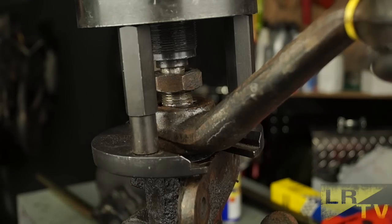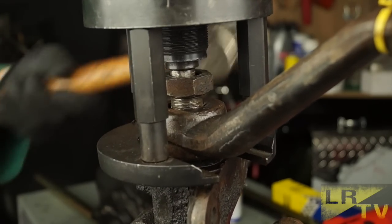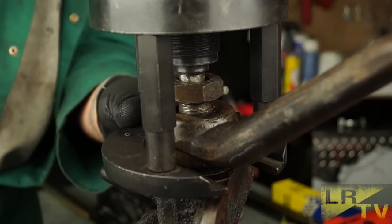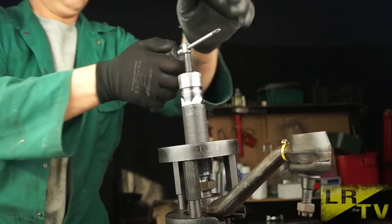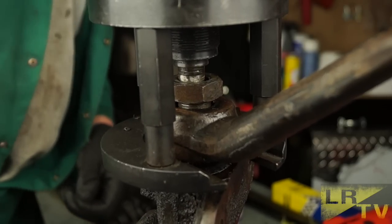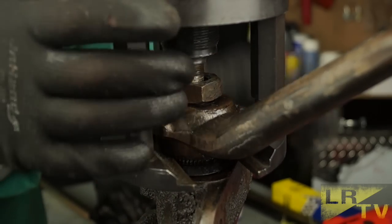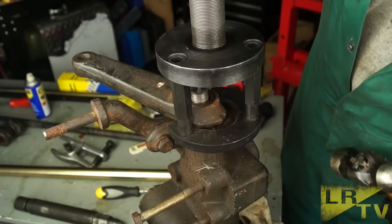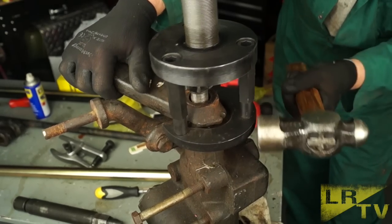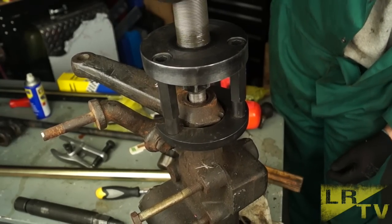On our TV channel, we like to review stuff and give our opinions. You can't knock Sykes Pickavant — they make pullers that work for the garage industry, and any good garage will have a set of their pullers. The bonus with this one is that it's specifically made for Land Rover, so it fits snugly over the drop arm. However, the price is fairly prohibitive. You can see I've cracked it off and I'm pulling this off — this one's a tough one. The Defender and Discovery drop arms are different, but this tool does fit; it took a little bit of tapping to get it underneath the arm, but it goes on square and managed to pull this one off too.